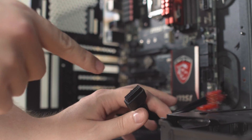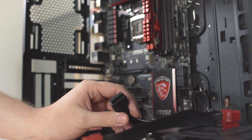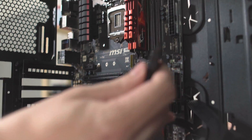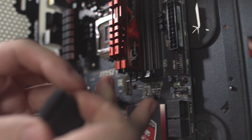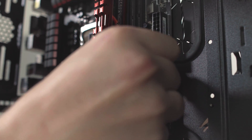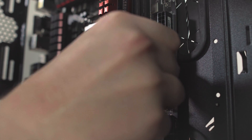This cable here, as you can see, is not one of our usual power cables. This one is actually coming from the case — it's our USB 3.0 headers, which run around the back of the case leading up to our front USB ports. There's a little USB 3 hub port here, and you'll notice there is a filled-in hole which matches a spot where there's no pin, so you know which direction to put it in. Just plug that one in without bending the board too much.